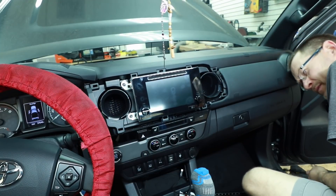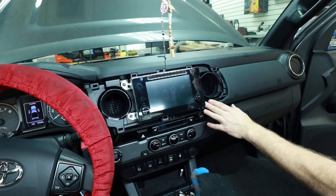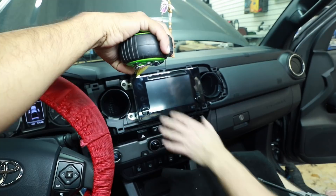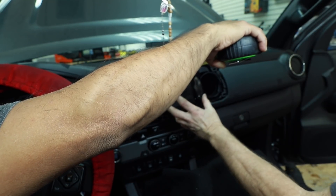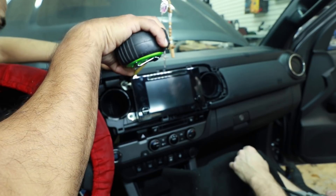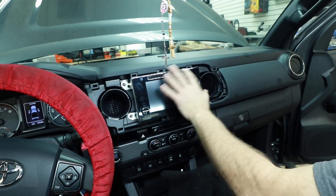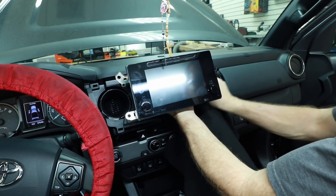To get the dash bezel out, put your knuckles on the dash and pull and push at the same time, working toward the steering wheel — the whole piece just comes right out. Four 10-millimeter bolts give you access to the radio. One thing we noticed: the factory radio is actually crooked in the dash — one side is pushed in further. The factory radio is not straight; it's shorter on one side by more than a quarter inch. If your radio looks uneven after install, shim that side out — we use a quarter inch of foam to do it properly.